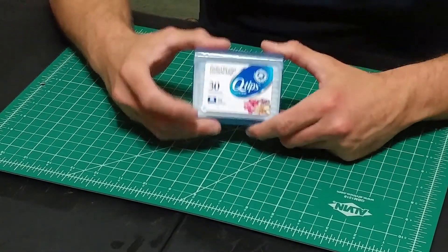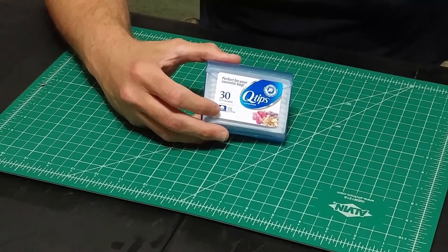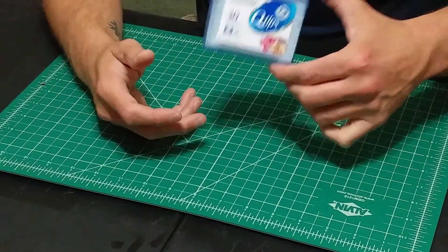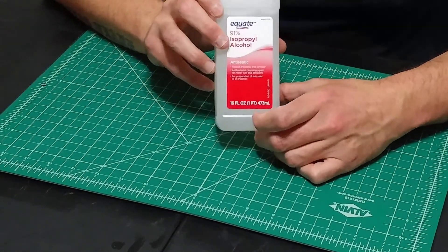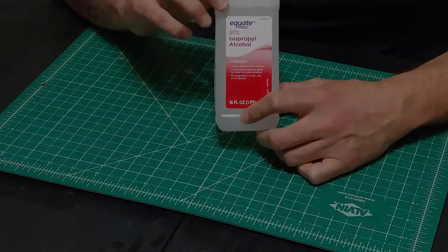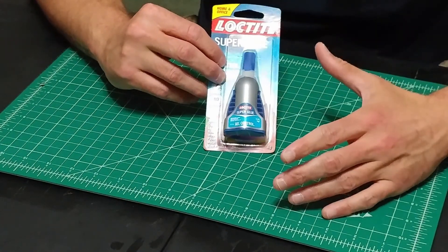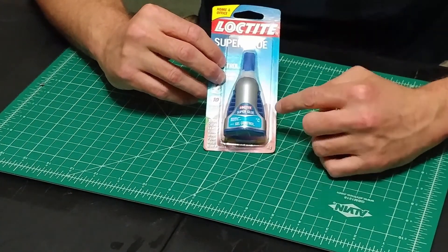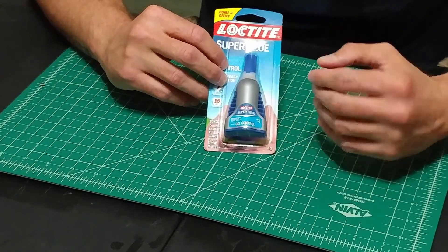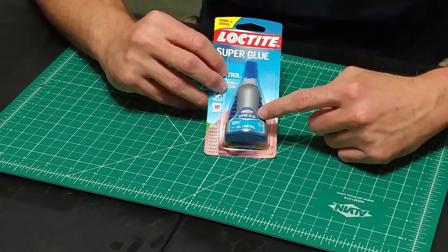To spread the liquid metal we're going to want some q-tips. The liquid metal I used came with some, though I suggest having a spare on hand — I went through a lot of q-tips spreading liquid metal on my CPU and heat spreader. You'll also need some 91% rubbing alcohol and paper towels to clean up any thermal paste and liquid metal. Lastly, you'll want some way to reseal the IHS to the CPU. For this I'm using Loctite gel control super glue, suggested to me by the folks over at Rocket. Like fingernail polish, super glue seems the easiest and cleanest way to go.